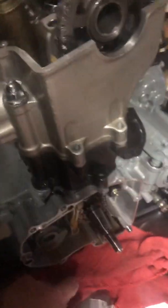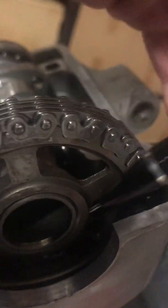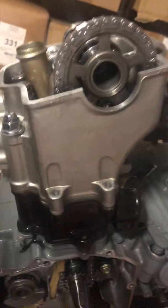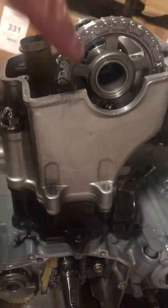Right now I have it right where I want it. Those two tick marks — right here and right there — need to be level with the head. The importance of this is that the cam chain connected to the crankshaft must run in sequence so that the piston is timed correctly to when the valves open and the camshaft opens those valves.